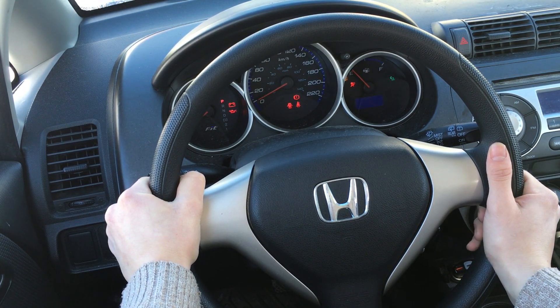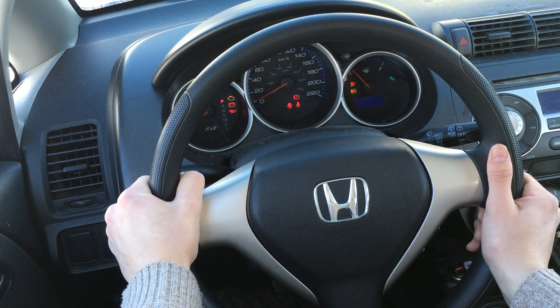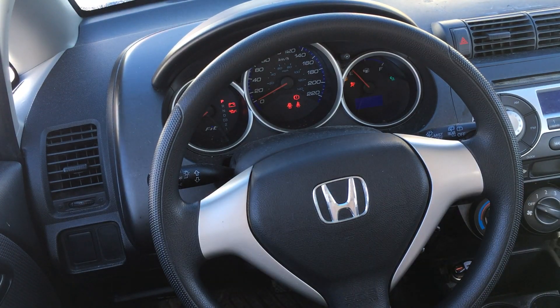In our instance, I'm not sure this is going to do much for us. This Honda Fit had an extreme pull to the left — it was very severe, and I think it is going to result in a rack and pinion replacement. I was hoping that relearning the torque and steering angle sensors would alleviate the issue, but in my prior attempts this has not been the case. While ineffective in my case, hopefully your scenario will be a little different. I know this tutorial can be very useful after a wheel alignment and things of that nature.